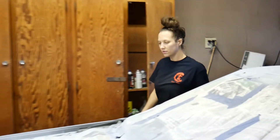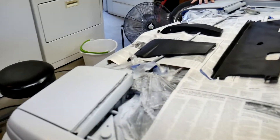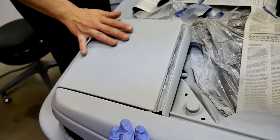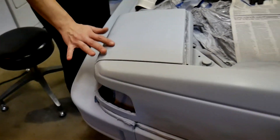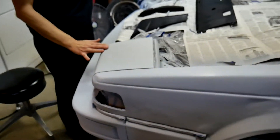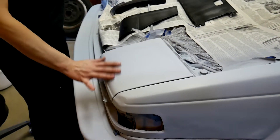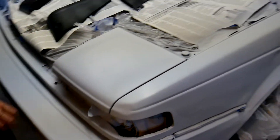So you felt that last night, right? Come check it out. I just wet sanded this — isn't that a crazy difference? That's a big difference. It's a huge difference, huh? I thought you did the roof — I thought it was the same. I was trying to show you the difference. It's like a freshly painted house wall. You can feel a little bit of orange peel, but it's like the tiniest bit. I'm going to finish the whole car and then we'll decide from there. I just did the fenders, the bumper, and the headlight bracket so far.